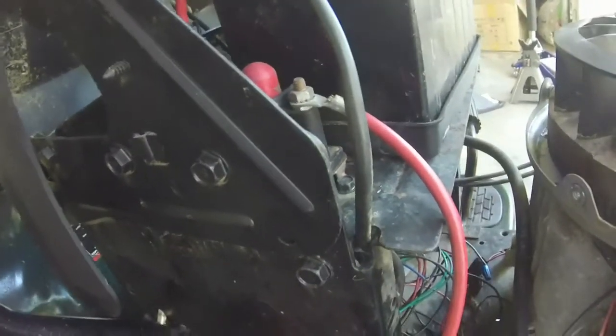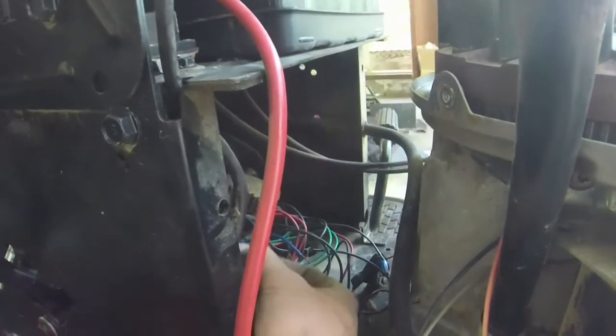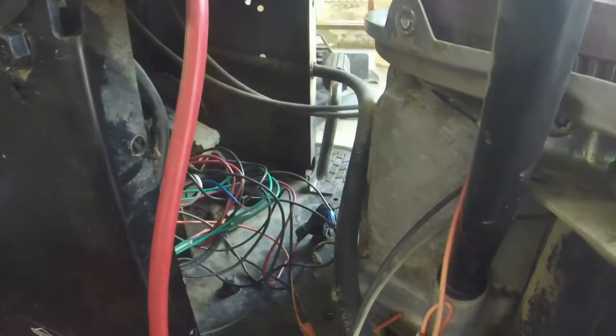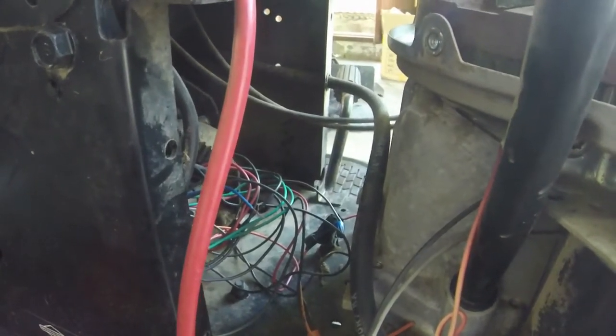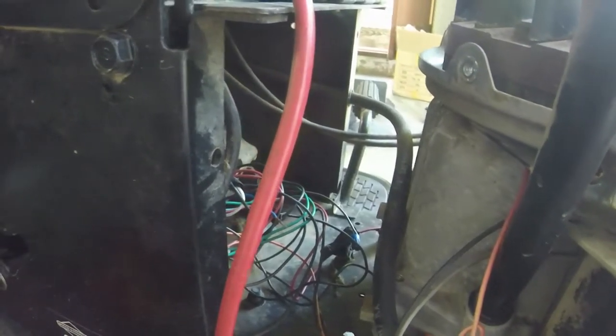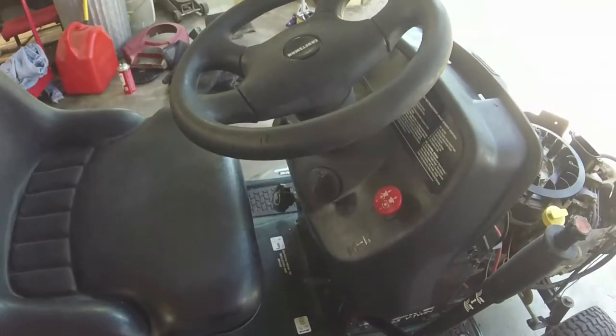The switch was testing good and I can't figure out why it's not working. That wire is coming straight from the magneto terminal, so I wonder... I'll keep investigating. I thought I had it. The sun glare had me second-guessing myself, and I was thinking — I didn't have the part breakdown — so I reconnected it.